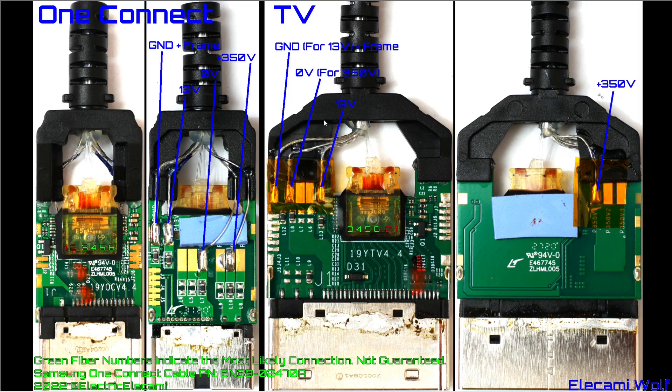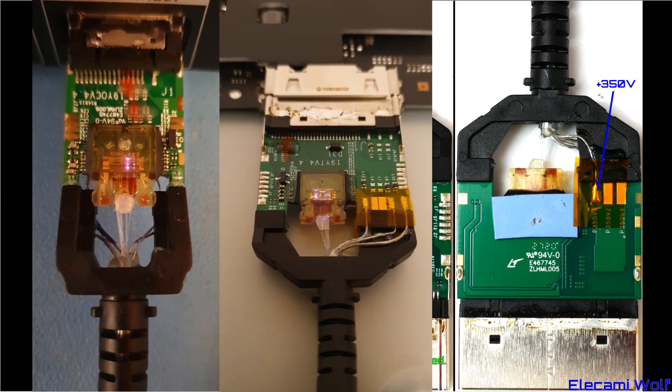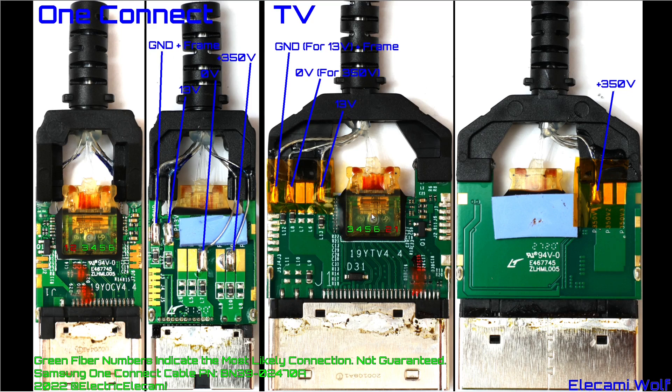Like what happened on the other One Connect cable — the one that has only fiber connections — I was able to see the order that the IR illuminated at both ends when powering up the TV. From that I was able to tell for sure what these two fibers were doing. Fiber one here, which is the end one, is fiber one at that end when they connect, and two is the next one over at both ends. So those two are known by the order they light up. These four, which will be the video data — I've only made an assumption of their order based on what we saw with the older One Connect, where the four fibers were reversed.